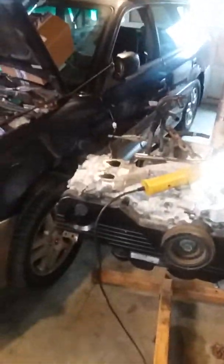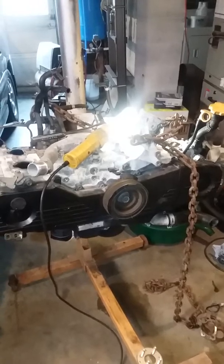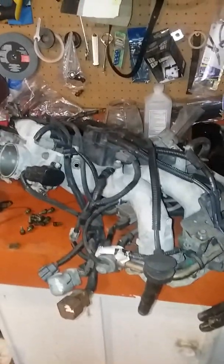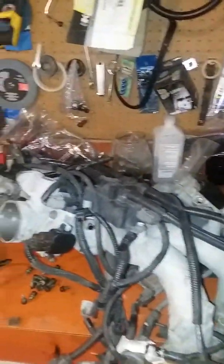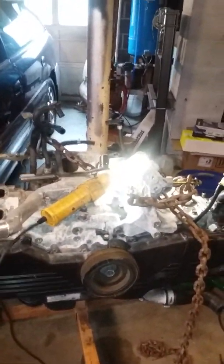Down here cleaning up — I've got the engine pulled out of the Outback, stripped everything off of it that I'm going to need. That's the old engine, it's pretty much a nasty mess. Here's the two-liter, and basically in a nutshell what you're going to need is these items here: the entire intake, injectors, wiring harness, and fuel system, which is really convenient on a Subaru because it's all made into one assembly. You can separate it all if you'd like, but it makes it really easy to just pull off.